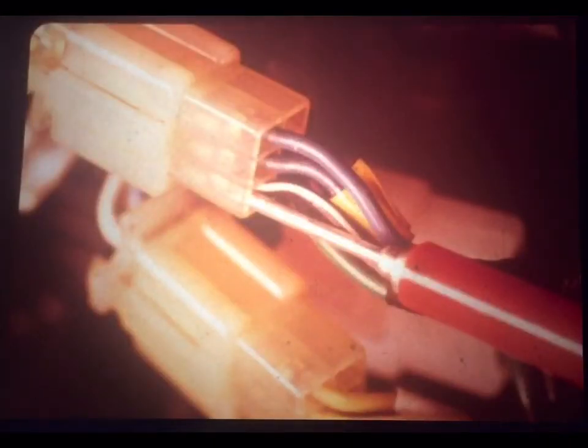And step 6 asks the question, Is there power to the spark unit? This test checks the spark unit power loop to see whether the circuit's okay from the battery to the spark unit and to ground. Notice that the spark unit connector should remain connected. And you'll connect a voltmeter between chassis ground and the black and white wire that feeds power to the spark unit.